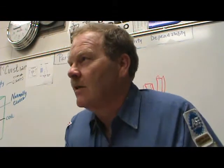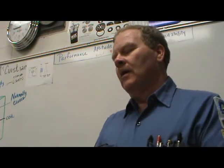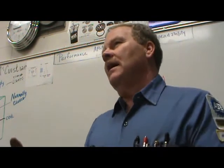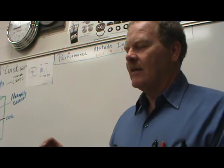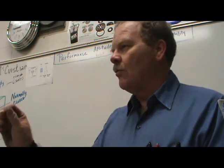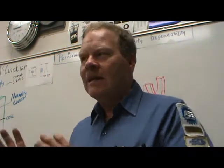And the guys that are really good, careful, and want to make sure they don't have trouble, whenever I've worked with guys like this, like if this guy had to put a crankshaft in, when he pulled his 2.8 liter out, he had to pull the timing components off of it and the crankshaft out. Well, he took the bolts that held the timing cover on and started each one in its hole, screwed it in a few threads so that the bolts were right where they were going to go, and it was really easy for him.